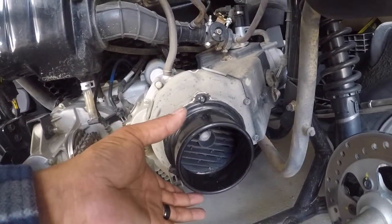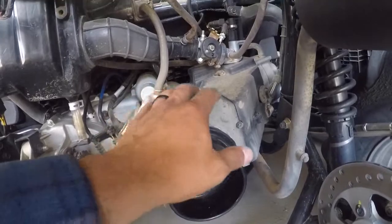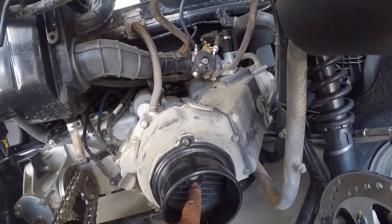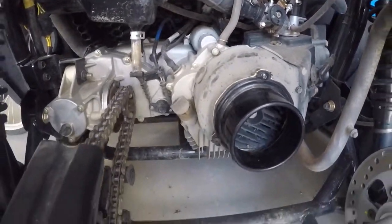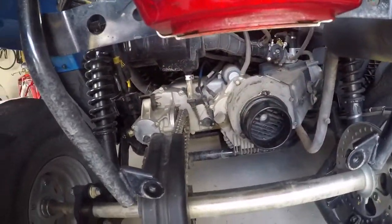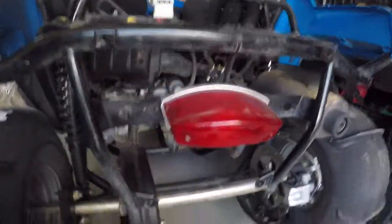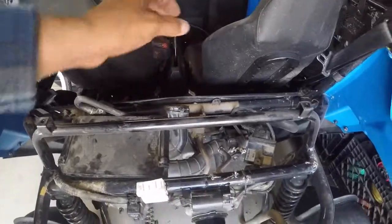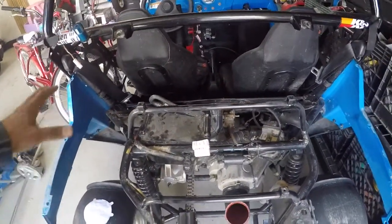When there's any kind of water or mud riding, the filter clogs up and it starts getting the plastic hot, which causes the impeller inside to lose air flow and the engine starts getting hot. So I did end up buying some 45s and 90s off the internet, and essentially I'm going to do a snorkel style — come up, kick out, come out the top, and put the K&N air filter up top.